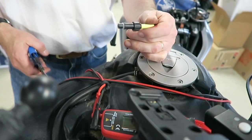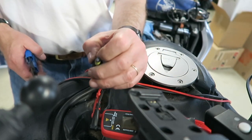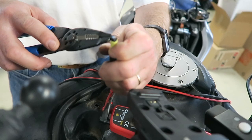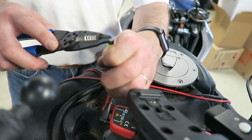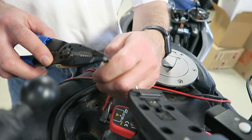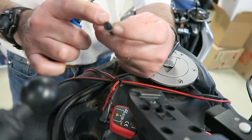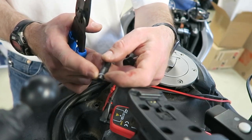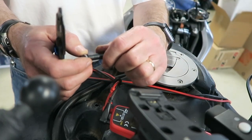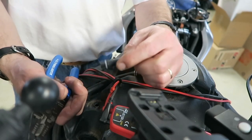So I really don't think there's any need to keep those, but if you actually get the Oxford grips, don't do this, obviously. But you can tell that inside the cable there's just two cables. This is a resistive circuit that's in series. They use a fairly low gauge wire, but unlike the Ducati ones, these are 100% waterproof. When you do get the Oxford, they come with nice O-rings on the connectors, so when you put these into the control unit, I didn't want the control unit on my motorcycle. I want to use the stock Ducati controls, so I don't need this, but these are 100% waterproof.